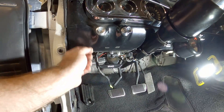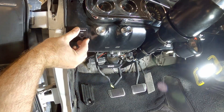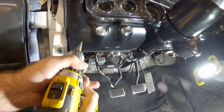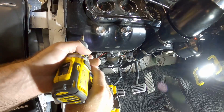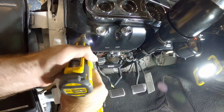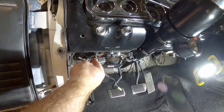I was feeling around behind the dash and I think I'd be able to drill this hole and fish the wire up through the back. I think we're able to do this without taking the instrument cluster out. I'm going to put the switch right in here — let's mark that. Guys, this is no going back from here, so if you don't want to do this, maybe you find a different way to mount the switch. We're trying to go to a half-inch hole, and I'm going to get a shorter bit so I don't have to drill so deep into the dash. Half-inch hole — done.